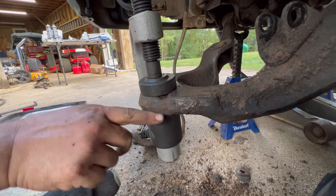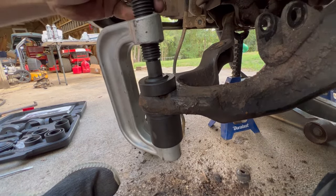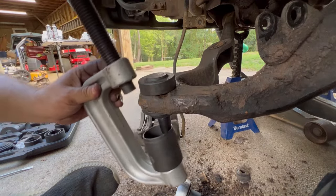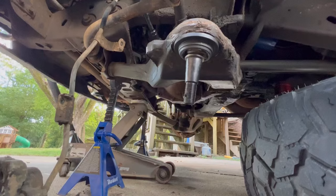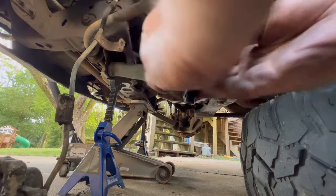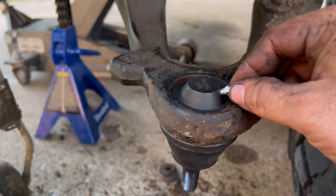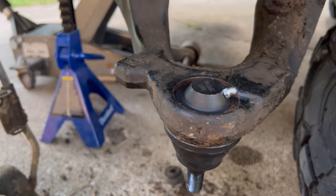It's flush with the bottom here. Let's remove the C-clamp and see what we did. Hot dog! Here's what it looks like from the bottom. While we're there, don't forget to go ahead and put that dust cap back on, because if you do forget, trust me, you'll be doing this job again real soon. Now we can go ahead and put our Zerk fitting in — just takes a little bit of patience, but there we go. We'll snug that up and be ready to rock and roll.